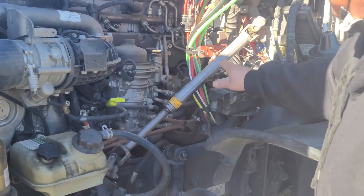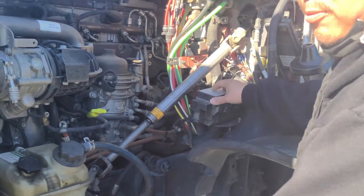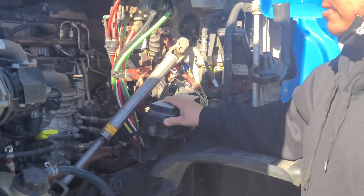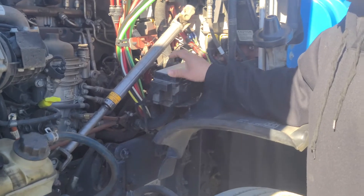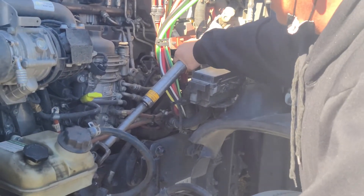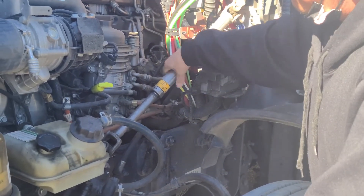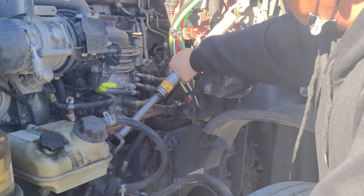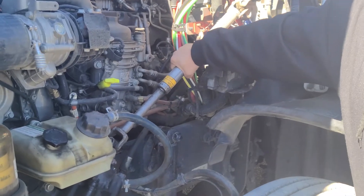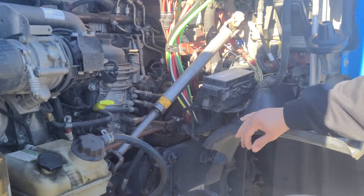As I come back out, this will be my fuse box. It's not cracked, broken, or damaged. It has all my extra spare fuses for this combination vehicle, and all fuses are properly rated. This will be my steering shaft — it's not bent, broken, or damaged. It's securely mounted by two U-joints, and when I pull at the center point, it has no more than ten degrees of play. The U-joint itself is not cracked, broken, or damaged — securely mounted, no missing hardware.